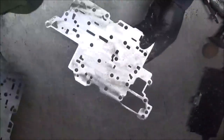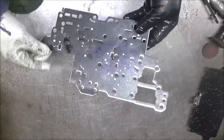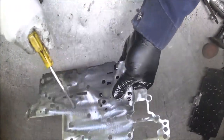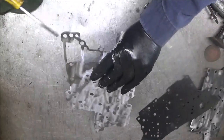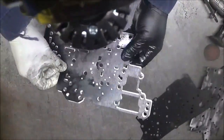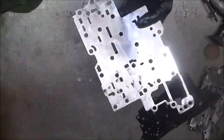I got both sides nice and clean. Don't get the gaskets mixed up — I know this gasket went here because I paid attention. When you do that, you want to blow with air because some of that gasket material might get up in there and plug some little tiny holes. There — it blows. This gasket goes here, and this gasket goes on this side.